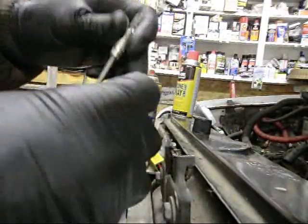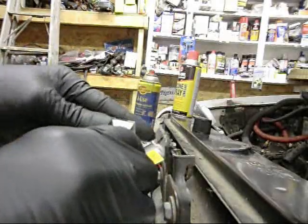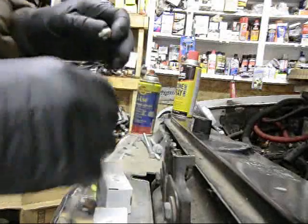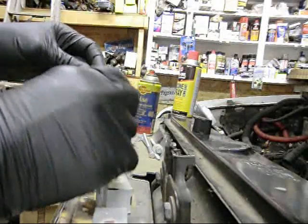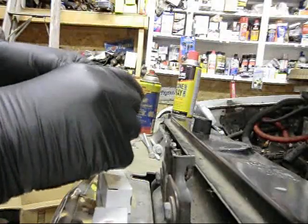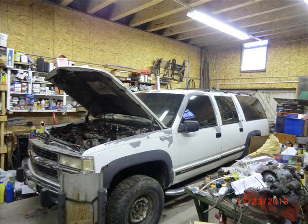So I got a couple of spares, and maybe once he figures out what's wrong, he'll buy some new ones, do some research, decide which are the best ones. The Bosch DuraTerms are supposed to be the best, but they don't light up as fast, but he has a longer glow time because of the buddy chip that was installed when I service the truck in Lompoc, California.